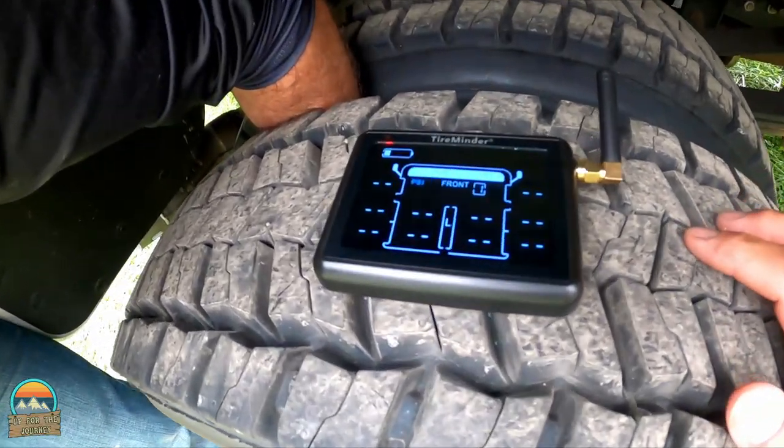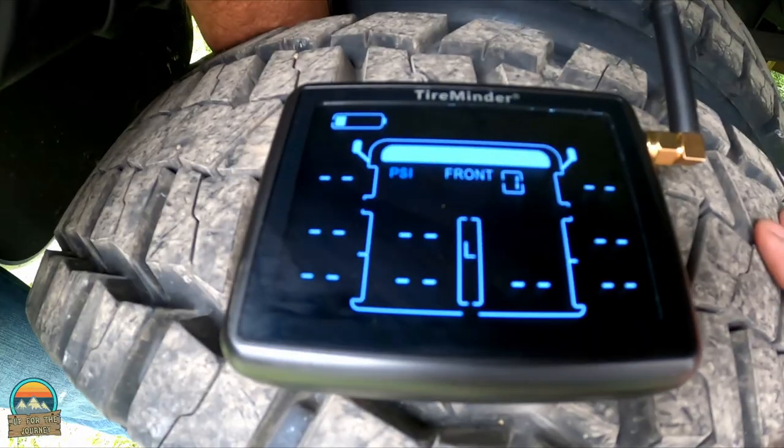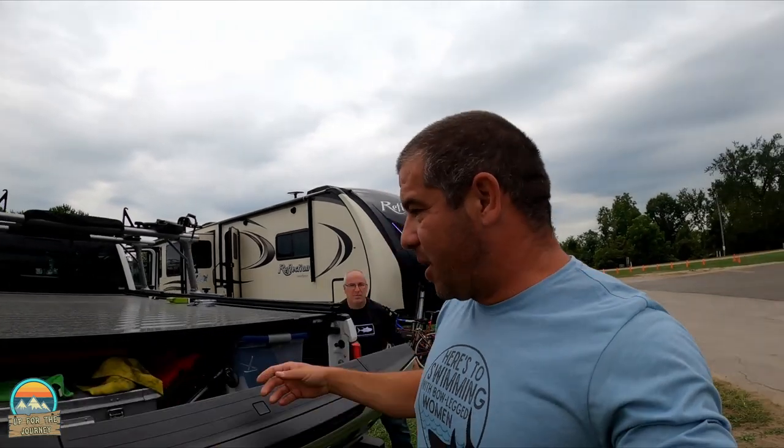Michael's got it on there and we're blinking here — you'll see 115 PSI. Normally I don't have 115 PSI on the tires, but we just installed commercial tires and they put in 115 PSI. It seats a little better that way. I drove it to get an alignment and now that I have the TPMS sensors on, I'm going to drop it down to the recommended PSI, which I think is like 85 or 90.